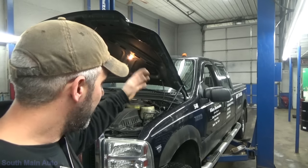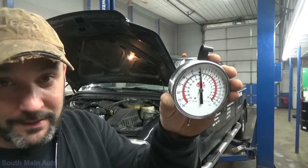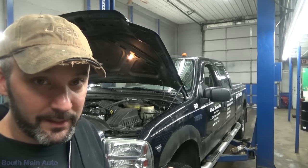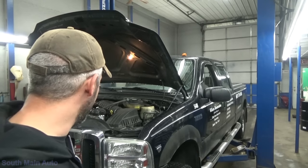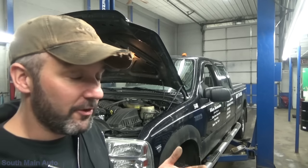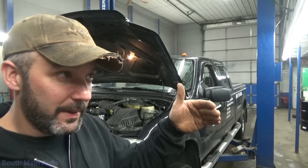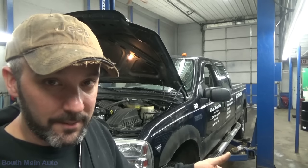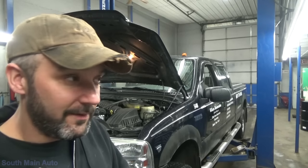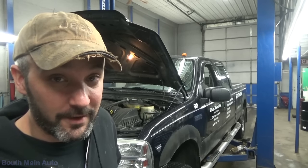I'll show you where some of the components are under the hood, then we'll raise it up. We'll kick it in and out of four-wheel drive. The most-used diagnostic tool on this type of job is just your standard vacuum gauge. I grabbed a pair of pinch-off pliers so we can isolate hub-to-hub. If memory serves me right, they engage at a higher vacuum, then once they're engaged I believe it releases the vacuum and sends a pulsed vacuum to the hub periodically on a timed basis. To disengage them they use a lower amount of vacuum, and sometimes that can take some time.